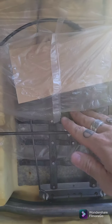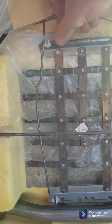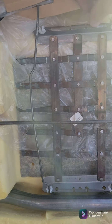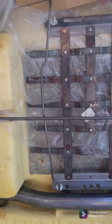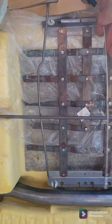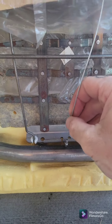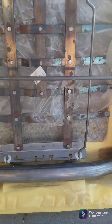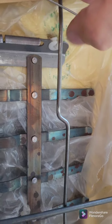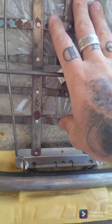All right, so that was quick — it's a very easy process. Once you lift up this little piece up here, you can just pop these rods out of these clips. First I got this cable off. If you loosen it up all the way so that it's in the most relaxed position, you can pull up a little bit and dislodge this from where it sits up in one of these slots. Then you can dislodge the bottom from where it fits down in one of those slots. And from there you can pop these old plastic clips off these rails.